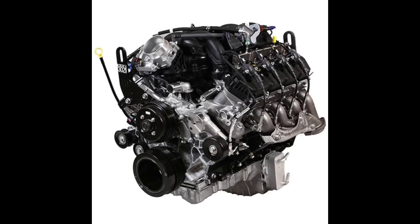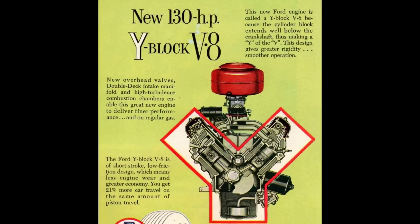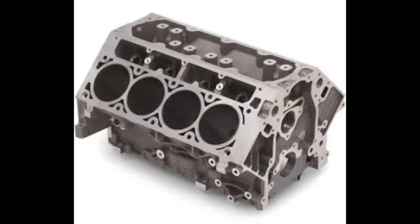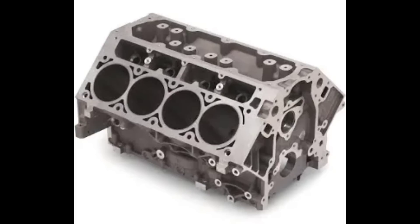There are some other interesting facts about this engine. First, this is actually a Y-block design and can trace its roots back to the actual Ford Y-block. Only the FE engine continued that design; it was abandoned on the traditional small block, the 335 series, and the 385 series. But when the modular series came out, it went back to the Y-block design and had cross-bolted mains like a 427 FE. As you will see, the LS is actually a Y-block design too — so who is copying who?